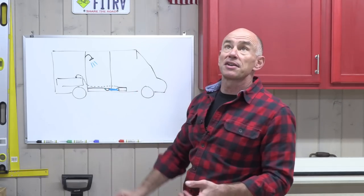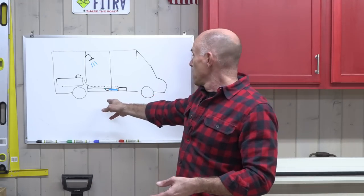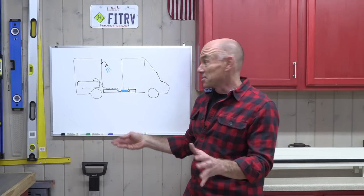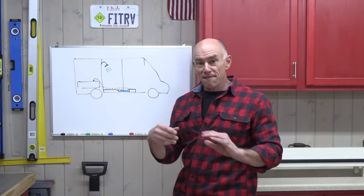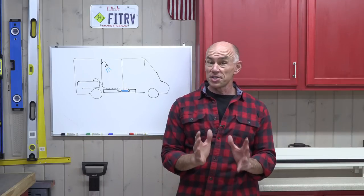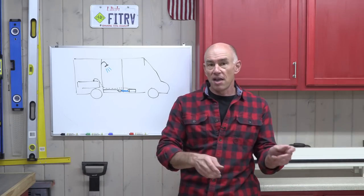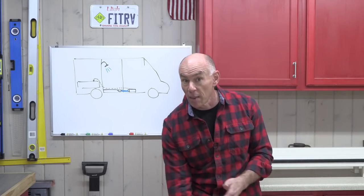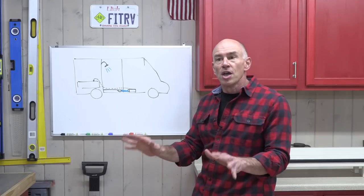And this pump is activated by a sensor. So when this drain detects water, the pump turns on. It's literally what it sounds like, and starts pumping water back into the gray tank. And that's fine. Normally, 99% of the time, you want to leave that switch on because you don't want to have to think every time you use a bathroom sink that you don't want water pooling up around your ankles because you forgot to turn the pump switch on.